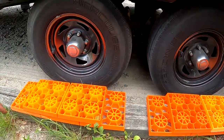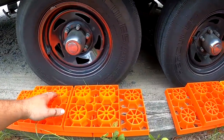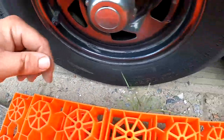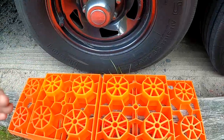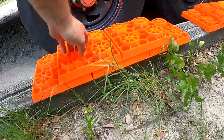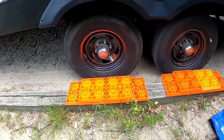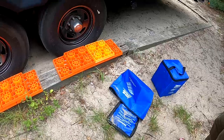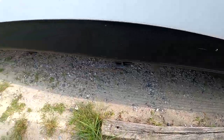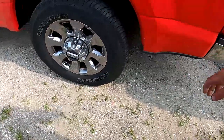This particular setup is a little more complicated because we're a little close to these timbers here. We'll mark this — that's exactly where they need to be. You can take a finger and draw where they need to be, because normally they'll be on the ground and you'll just slide them over. In this case, because we are pretty far off level as you can tell from the gauge, I've built two stacks up, which I think will be enough. The system is very modular, so it's easy to add a couple more blocks. We carry four of these, which so far has been enough to level everything we've needed. The camper is where we want it to be, which means the truck is where it needs to be.